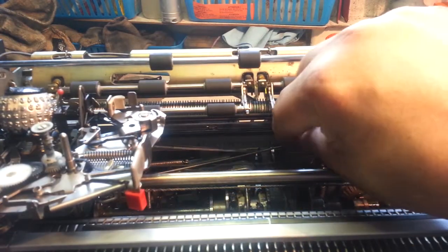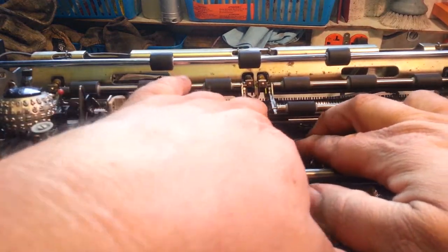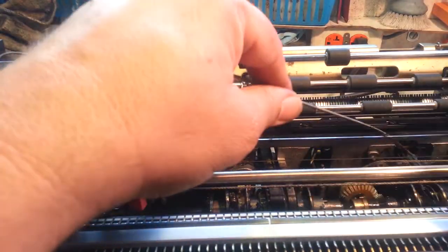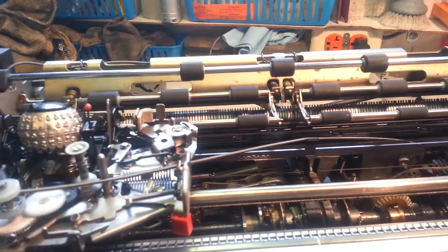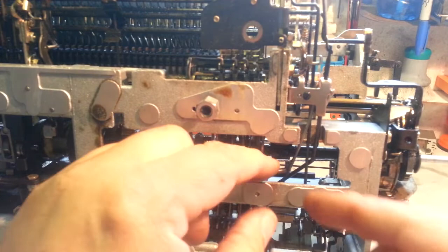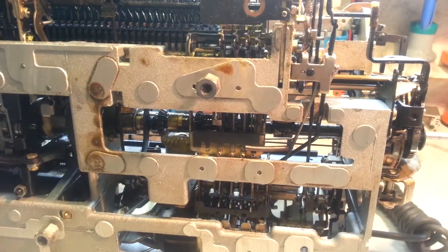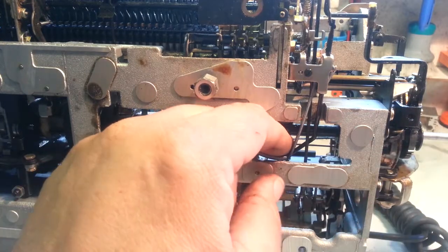and we can grab this bracket and just pull it off the frame like that. Pull this through. So now we got our bracket, and then it feeds down through here. So now we got to loosen this screw where the cable connects, and we're going to undo this spring. Only thing the spring does is hold the cable and doesn't interfere with anything else.